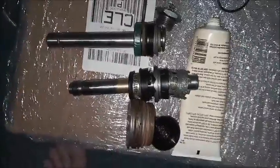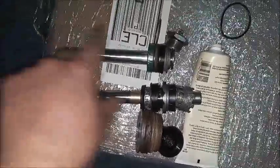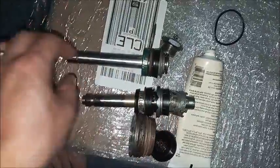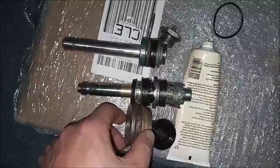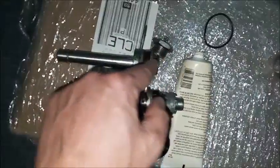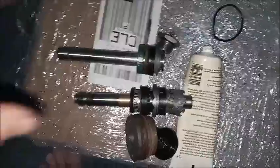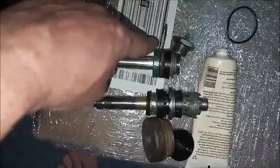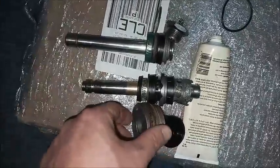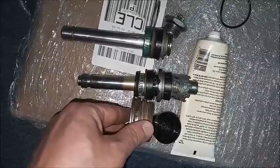And this is how they sit inside the master cylinders. The plungers move, the other parts stay stationary, except for the moving of the compensating valve. They apply in this direction and release in that direction. Snap ring on the Bendix goes about there, and the end plug for the Moraine is here.